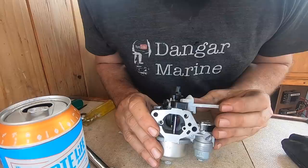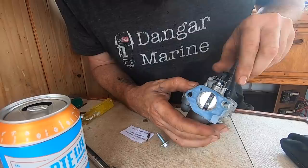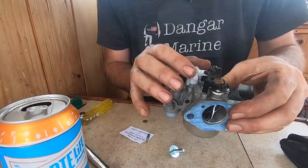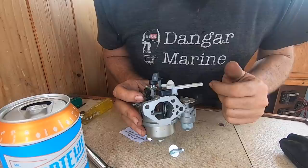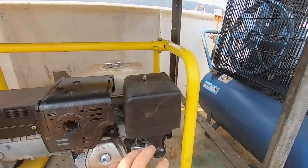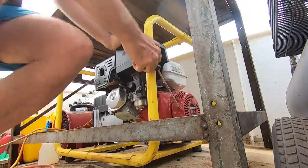This is the choke lever — it just actuates the choke. This one is your throttle plate. The choke is forward of the venturi, so if you open the throttle but close off the choke at the front, as the piston goes down it pulls a really strong vacuum and draws a lot of fuel out, until you open the choke and then the vacuum becomes lighter and you get the correct measured amount from the venturi. I think we're in business. Fill this up with fuel and see if it leaks — fuel on, no leaks, choke on. Mission on. Success.